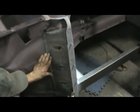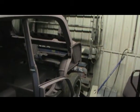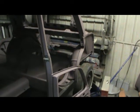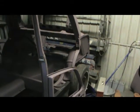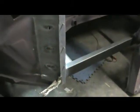I'm going to go check on the rear door hinges. Can you go ahead and fix that hole below the striker? Or do you need to fit the door first? Yeah, well, I should fit the door. Because that might have collapsed slightly or something? Yeah, it's squished a little bit? Squished. It's hard to say. So I got to pull it out. I brought the slide hammer in. So we'll get this tacked in, get the door hung.